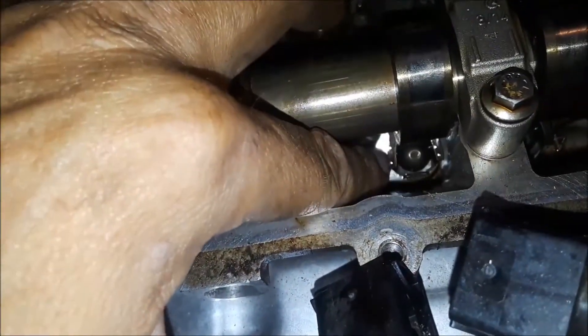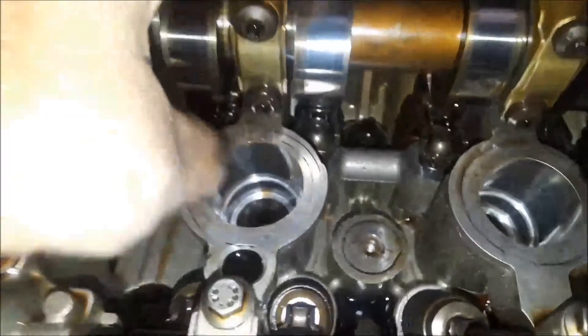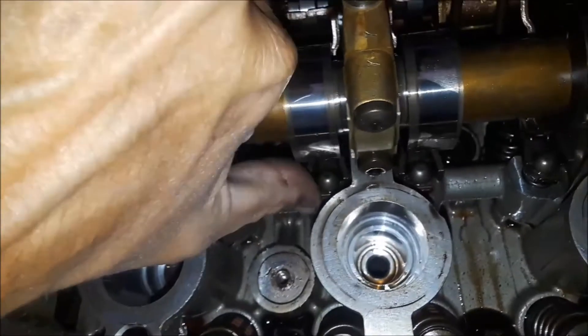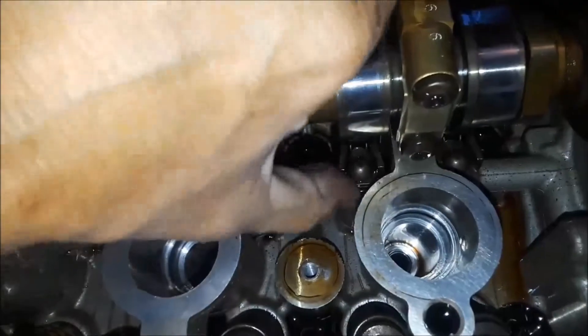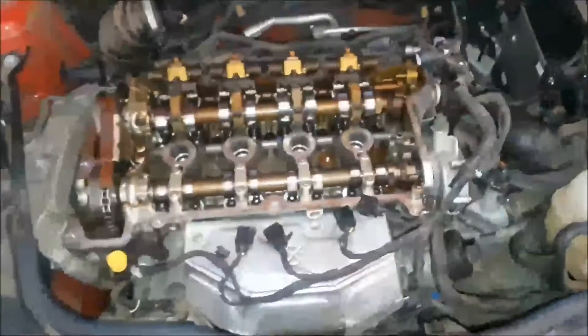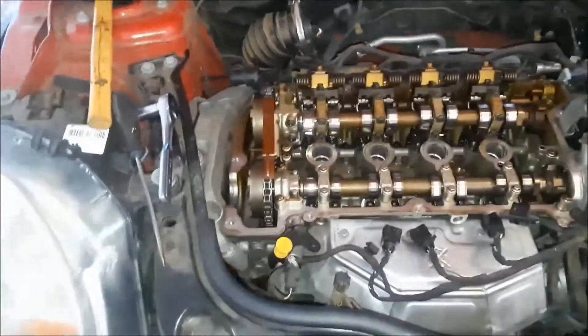I was thinking the noise had something to do with this valve being stuck, or one of the valve lash adjusters — commonly called lifters in older engines — and this is the only one. The noise while running was very little, just a small rattle, almost drivable, almost like a normal sound. But the previous owner would have known what's normal.